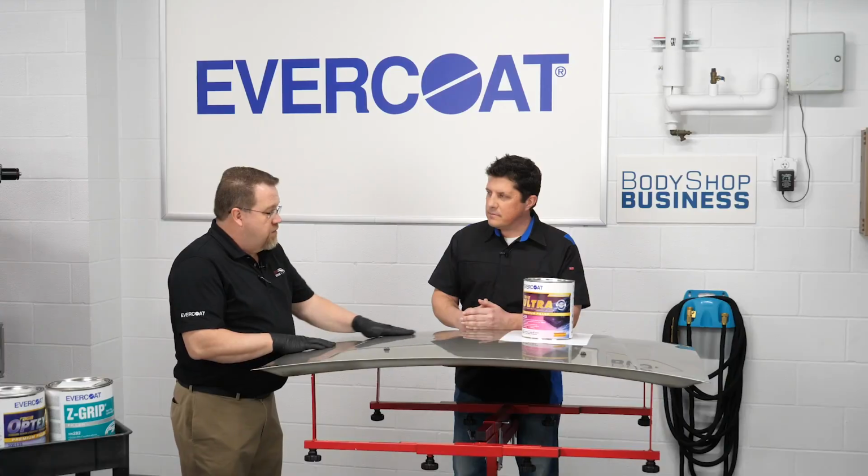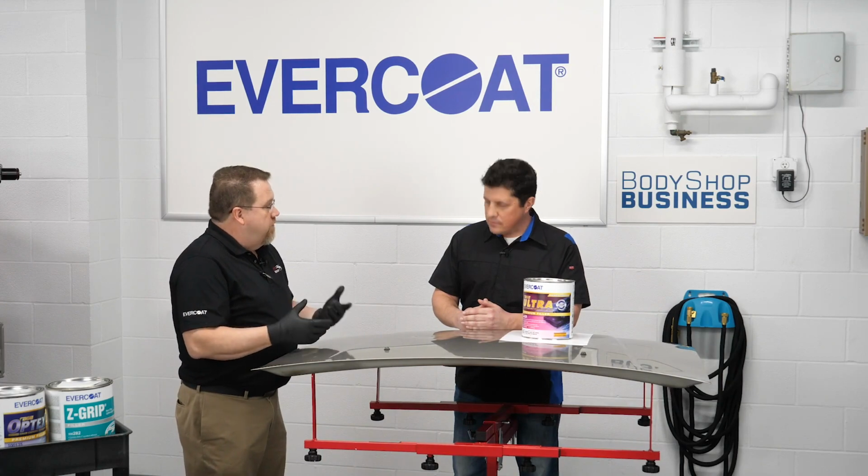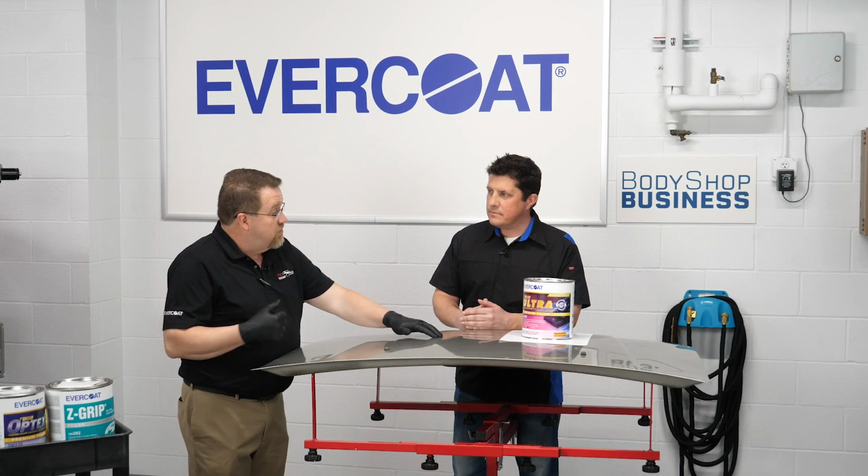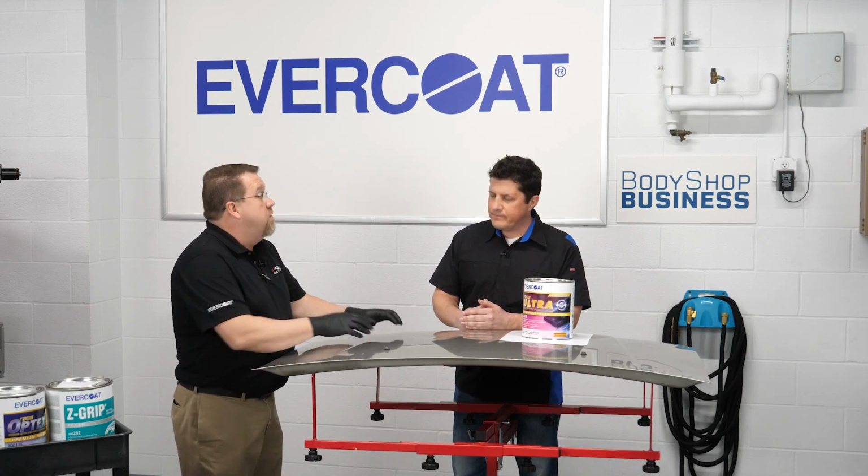That goes back to the grinding we talked about. Absolutely. Yeah, we talked about grinding from another scenario where over-grinding can create more of an issue for pinholes. So, for repair like this, a lot of times the go-to product might be to start with the grinder. You're actually doing more harm than good to the substrate itself, because what if this were aluminum?